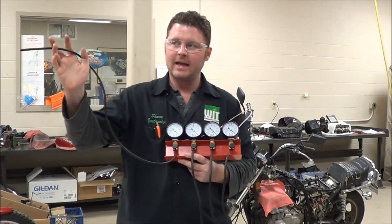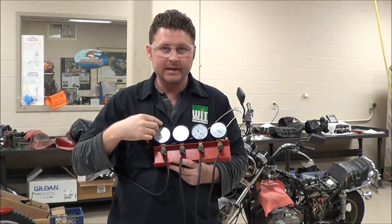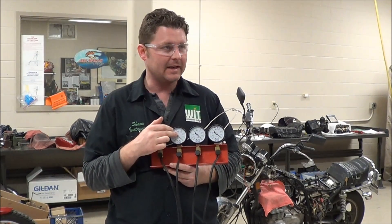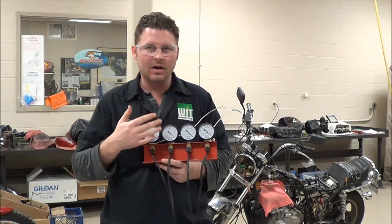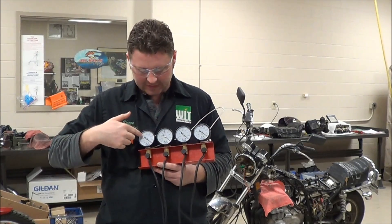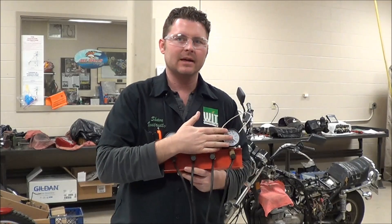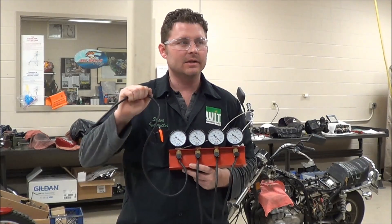Here's how we check it: let's say I have a four-cylinder vehicle. I'm going to take one gauge and put it on one motorcycle vacuum port and see what it reads, then do all the other gauges. For demonstration, let's say they read 20. Well, that means this gauge read 19 and this gauge read 22. So now when I go to set the carburetors on this bike, I can't set them all equal because the gauge itself reads a little different. But if I set this one 20, 19, 20, and 22 — are the carbs synced? Yeah. Can you imagine how much human error develops right there?